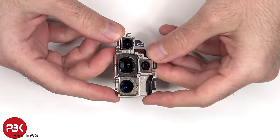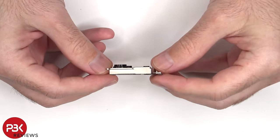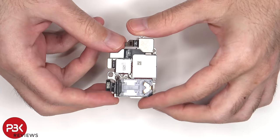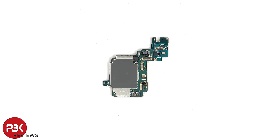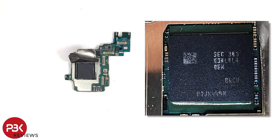Here's another look at the camera assembly. Once that's removed, we can see another microphone located over here, and there's a heat transfer film and compound over the processor. Once that's peeled back, we can see a thermal pad underneath. Once the thermal pad has been removed, we can see the RAM which is seated on top of the processor.